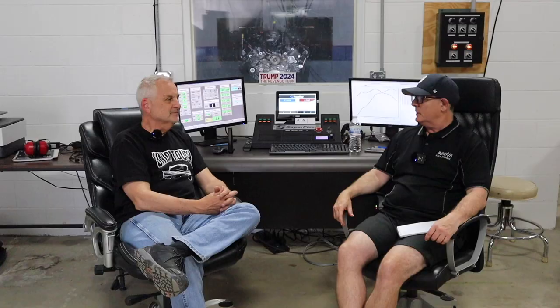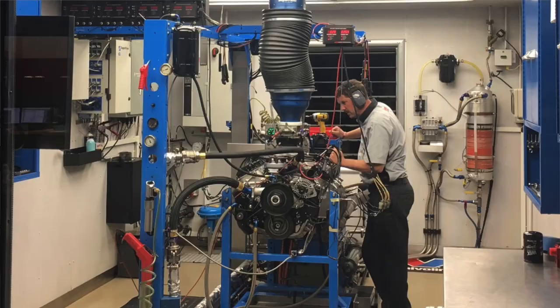Also ask whether an inertia correction factor is included, and if so, what that value is. You shouldn't be pulling in 130-140°F air in most dyno cells — normally you're pulling in outside air. If you hear hemming and hawing when you ask about the inertia correction factor, it might be a sign the number was unreasonably high for the combination. Generally, testing on a hot summer day should correct up, while testing in December in Michigan should correct down.